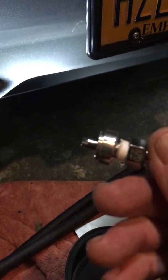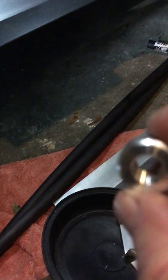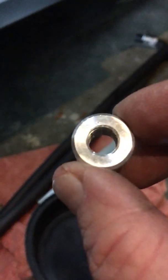We're going to be adding a coolant temperature sensor. Got the bung here. So it requires a 1/8 inch NPT bung. And this is the smaller one because I have ones that are much bigger than this and they're not going to work. These tanks are small. So that'll be beautiful. And basically I have one in the Sports Machines lower. So I'm going to be running two sensors. I had two sensors in the lower.